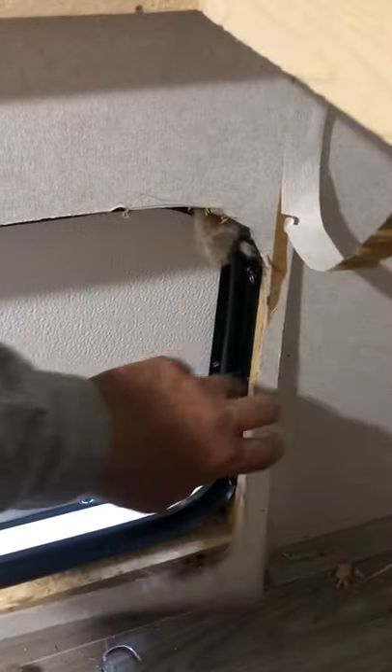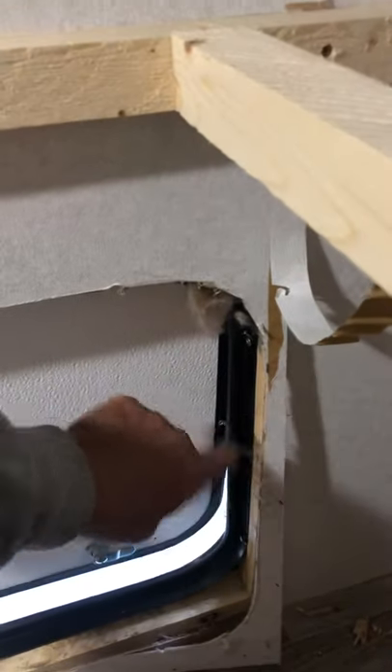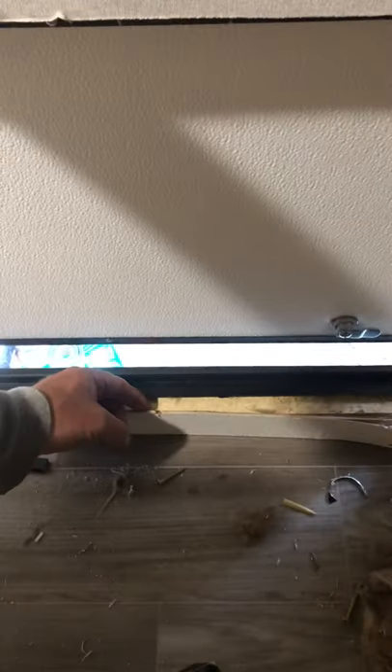I started my work inside to make sure everything would go well. I came in, took the bed out, and found the tape covering the seams. I knew there would be a stud behind that, so I pulled the Luon back and measured how far from the break to the edge of the stud. Then I measured from the bottom up how much I needed to cut on the Luon and added a little bit for security.